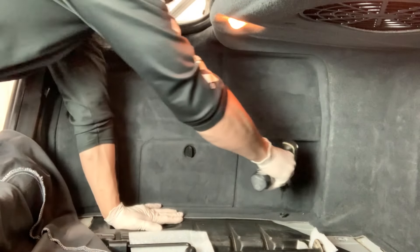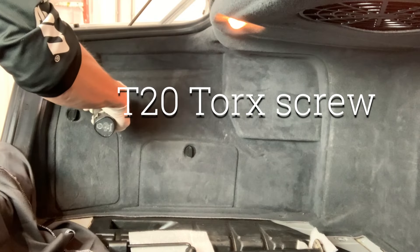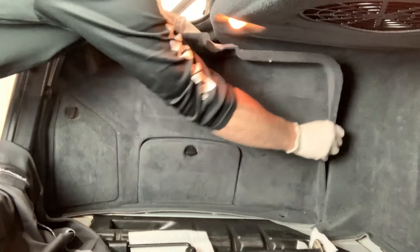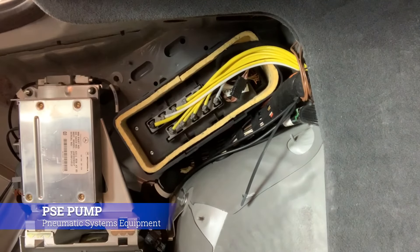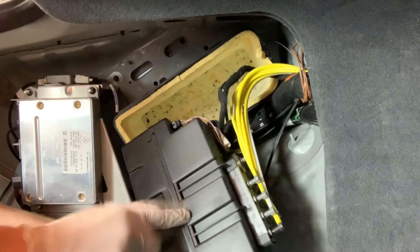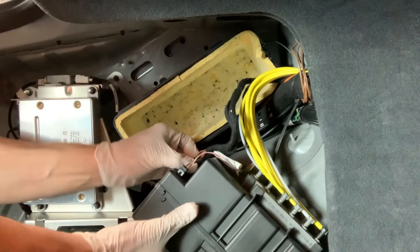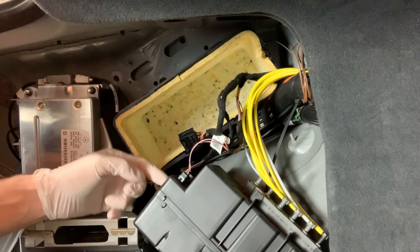It's pretty easy to access. Remove the screw here, two screws on the side panel or the rear panel, one pop rivet hiding up here. Then you can flex the panel down, move it from the rear and angle it out. Hiding here in the corner is called the PSE — it stands for Pneumatic Systems Equipment. Inside here there's a vacuum pump. The vacuum pump works the air pressure for the locks. Sometimes you can unplug the connector and check for corrosion in there, because it sucks air in and out all the time, it builds up moisture on the circuit board.